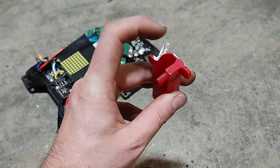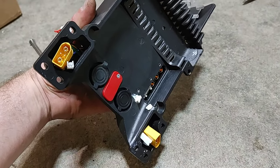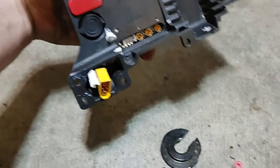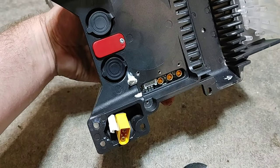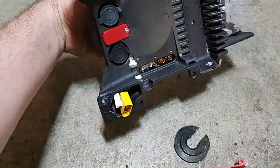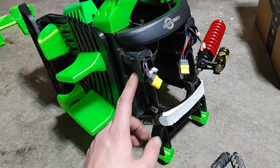There's a red cap that sits over that area and the wires go through with white silicone — I wouldn't say that was any serious protection. But like with some other wheels, the likelihood that water is going to go up into that channel and continue up to those connections is pretty slim. Between that plastic and the bottom of the metal piece there is also no gasket. So if you want to waterproof your wheel further, it's easy to get to those screws, take off that little cover, and put some silicone or black RTV on that piece before you put it back. The charging ports do have covers. All in all, this wheel is actually very, very waterproof — one of the best I've seen.